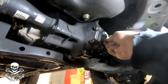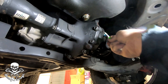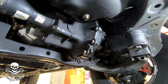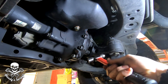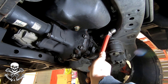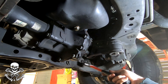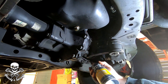Give me the best chance of getting those loose. I'm going to hit the drain bolt too, and then give them a little baby tap with a hammer just in case there's anything that might break up. And finally I'm going to hit them with a little bit of penetrating oil.